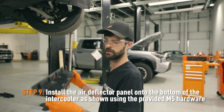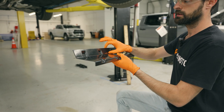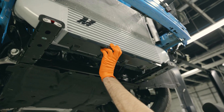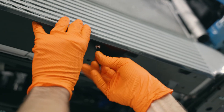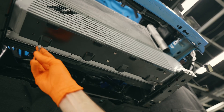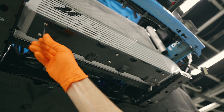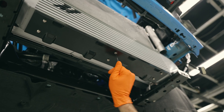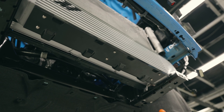So the next step, we're going to install this air duct to the bottom of the intercooler. Proper orientation is the longer side tab facing up and towards the rear. Just line it up with the holes in the bottom of the intercooler. With the kit there are six M5 screws, lock nuts, and washers provided to fasten this to the intercooler. This is a 2.5 millimeter Allen for these screws. Put them in loosely until we get them all in, then snug them up — not too tight because they are clamping directly against the plastic. A good way to limit the torque is to just use this little wrench so you can't over-torque them.